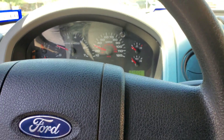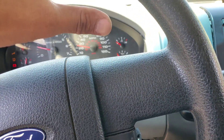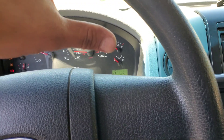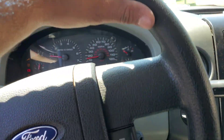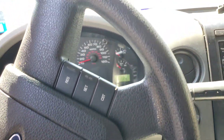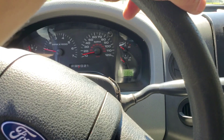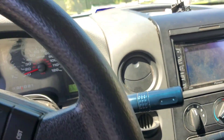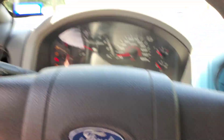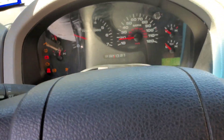I don't think I'm gonna get that temperature gauge, because that is different. The 4.6 has engine cooling temperature, and a Coyote takes its temperature from the head. So that'd be a difference in variance — cooling temperature versus cylinder head temperature. That's where they differentiate. I wasn't expecting the temperature to work, but we'll go out to the road and get her going.